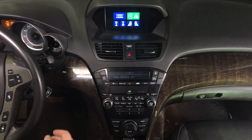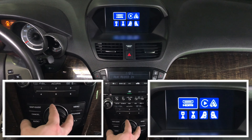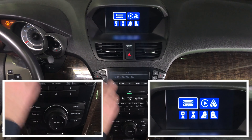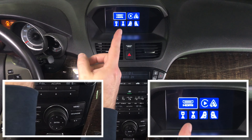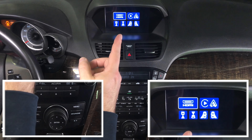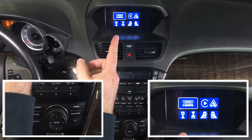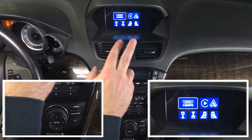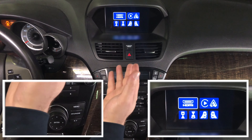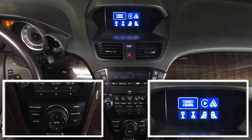To switch between the interface and the factory screen, press and hold the cancel button. You have options: HDMI, CarPlay, Android Auto, and camera inputs. There's a rear camera which is factory, so we're not using that. You can add a front camera — out of reverse and into drive, the front camera stays on for up to 10 seconds, which is good for parallel parking. You can also add left and right cameras to watch your blind spots, and use the camera inputs for a DVD player.